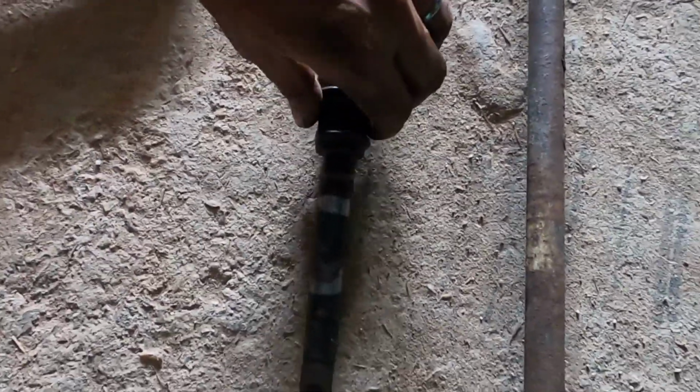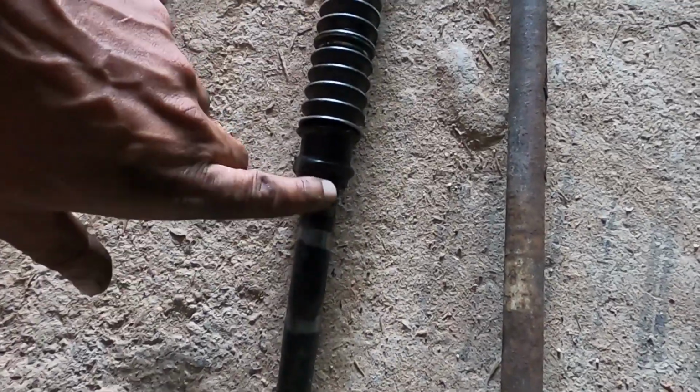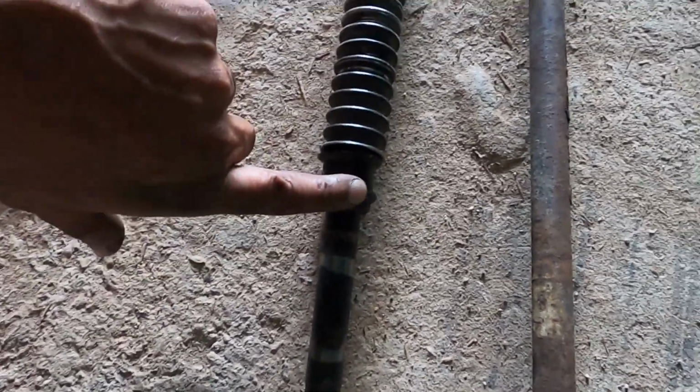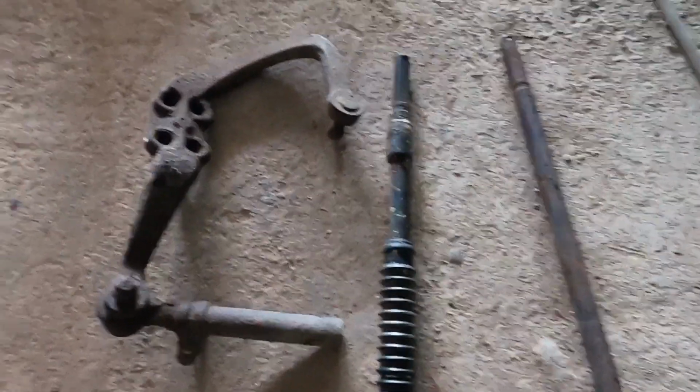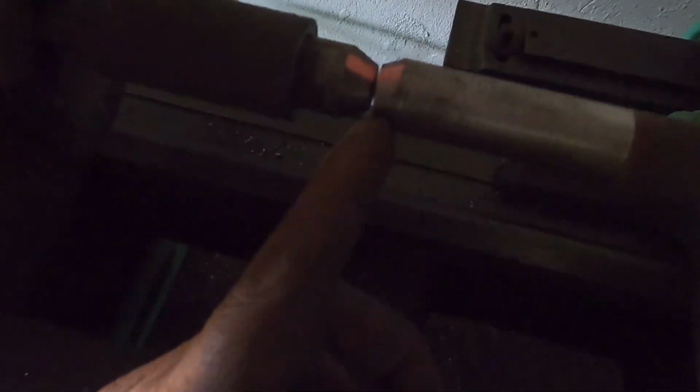So, about to get to work on that. I will machine this part out on the lathe. Yeah, we have our lathe there, so we'll machine this part out, butt it up, weld it off, and see. Here we are just machining on the shaft for a bit of a bevel in it, cut both of them to length, 22 inches, and made this sleeve, bore it out. So when we weld the steering rod, we will just sleeve it and weld it off.